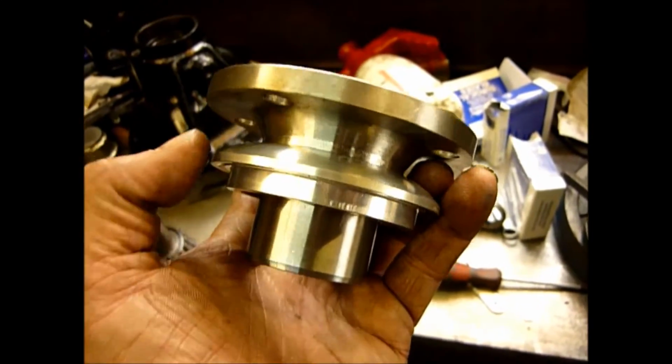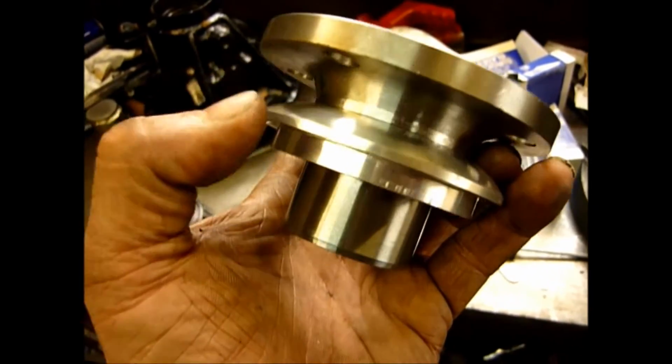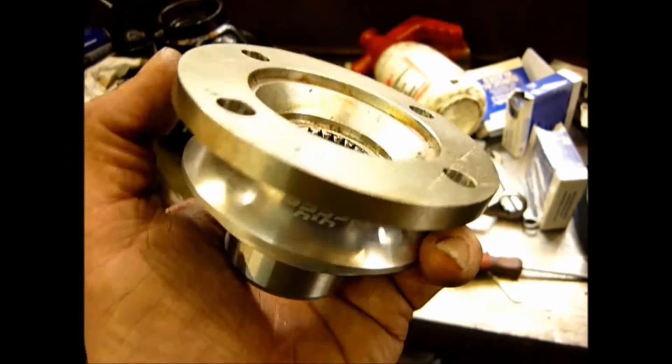Another little tip, which most people look at me as I'm absolutely amazed, is pop this steel unit in the freezer overnight and you'll find this fits on a whole lot easier. Just the coldness and this shrinking, just a teeny weeny amount, you'll find that just goes on a dream. When this is hot and this is hot, it's a different ball game.